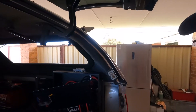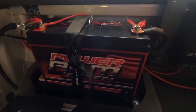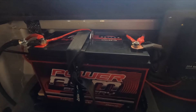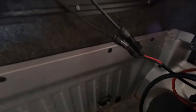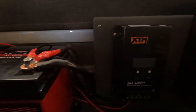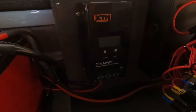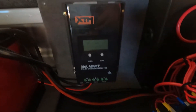Right, let's crawl in. Here we've got the power battery which I said before - 135 amp hours. It's just one at the moment, I'll be getting another one. Got a bit more room here to put another one. That's my solar lead at the moment, I'll tidy it up when I get around to it. The XTM 20 amp MPPT solar charger. Put the wires through, that's all working correctly.